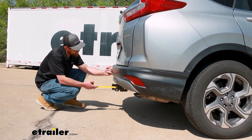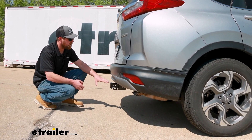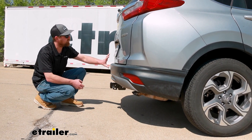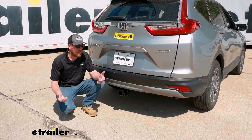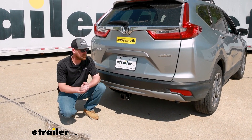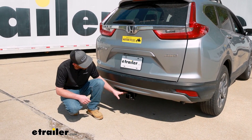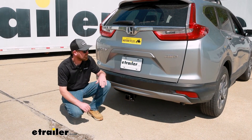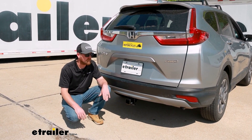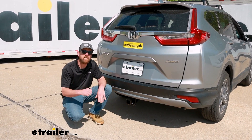From the center of the hitch pin hole to the edge of the rear bumper, that's going to be three inches, which is really good. You can use that to help figure out if any folding-type accessories can be stored in the upright position without hitting the back of your Honda. Aside from that, this is a good all-around hitch — it looks good, is capable, and lets you do a lot of different tasks. As far as the installation goes, it's really not too bad. You will have to trim a small portion underneath your fascia, but for the most part this just bolts up — you don't have to drill anything. If you'd like to hang around, feel free to pull into the garage and put it on together now.